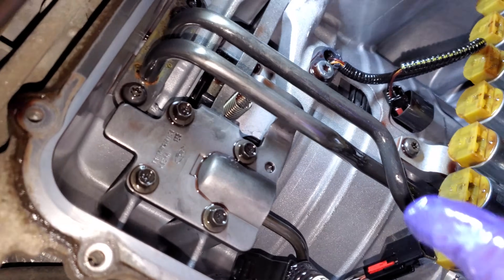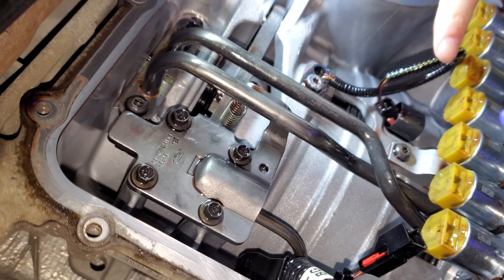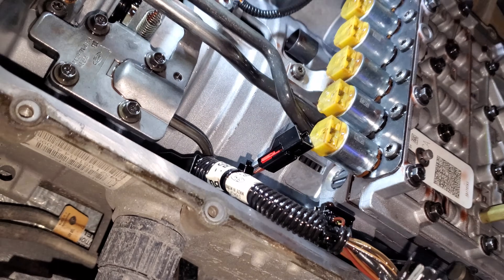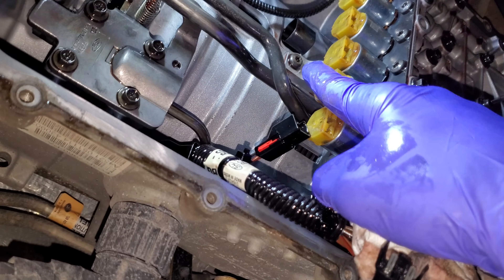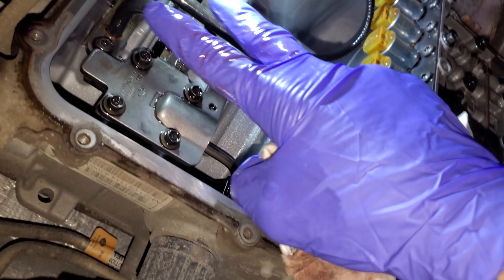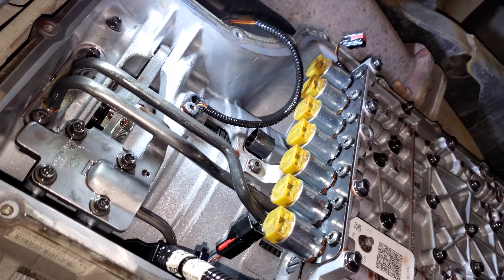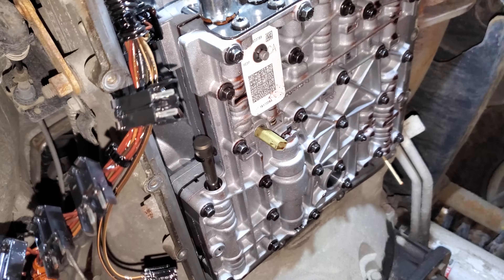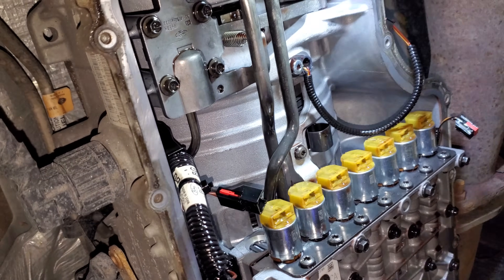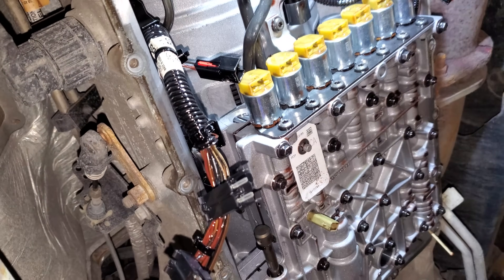Right here we have a Torx, a Torx, and a Torx. So what I'm going to do first is rip those Torx out — that'll have this free, kind of floating — and then I'll come through and rip out the rest of the bolts. So we have three bolts to take out. Let me get these feed tube lines out of my way and then pull this all down as an assembly.